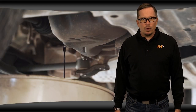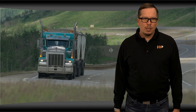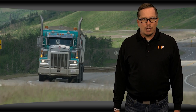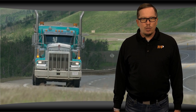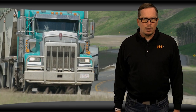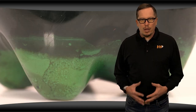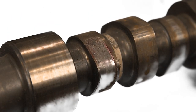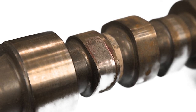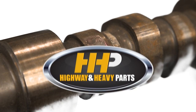It's also important to do regular oil changes to ensure everything is working properly. It can be tempting to try and push it a few more thousand miles, but this can cause damage to your camshaft and could end up costing you more money in repairs than if you just change the oil regularly. Doing oil samples can also help you diagnose an issue with your camshaft — it gives you a chance to check for metal shavings, which are often a symptom of failure and can damage other lobes on your cam. They can even travel downstream and damage other components.